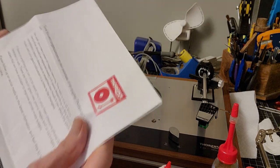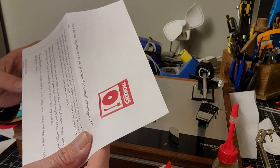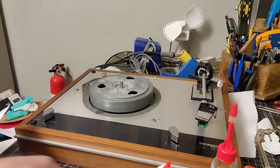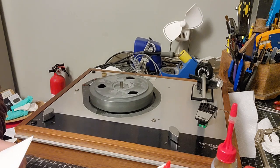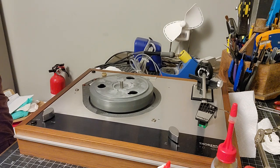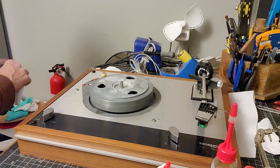You could probably stretch it longer depending on how much you use your turntable. If you're not using it very much you could get away with much longer, but if you're using it all the time, three to five years is a good rule of thumb. If things start slowing down because it's stretching, that's the time to change your belt. Also monitor your lubricant — if the turntable starts slowing down it could be your lubricant getting too thick and viscous. Monitor it with your strobe and you'll get a really good idea of how well your turntable is performing.